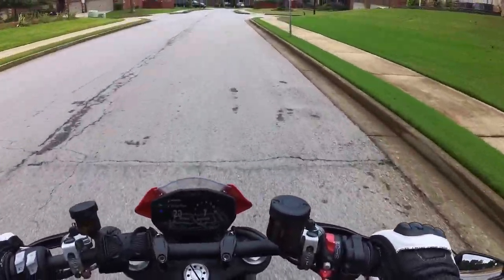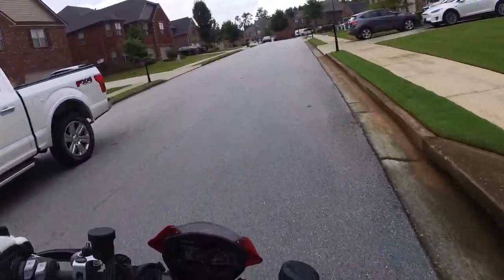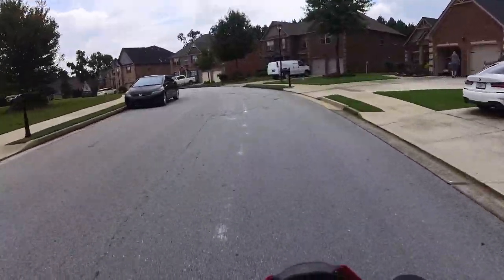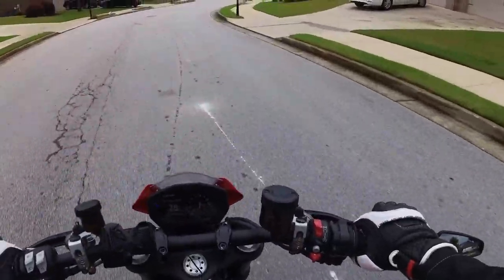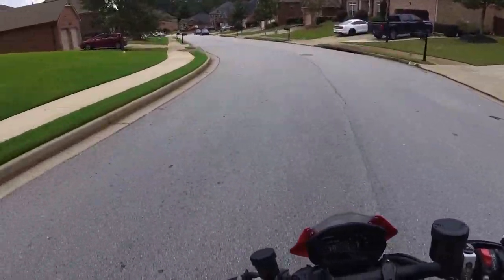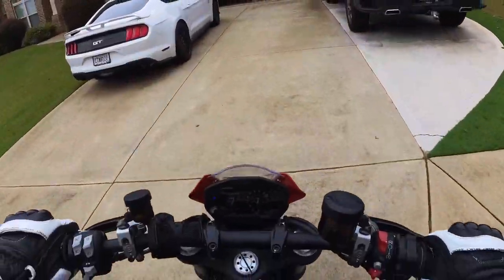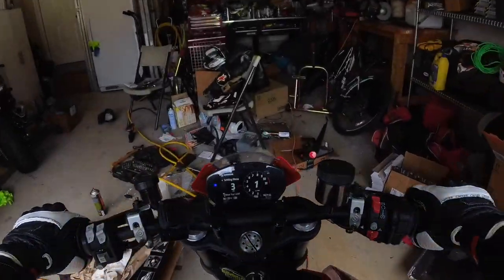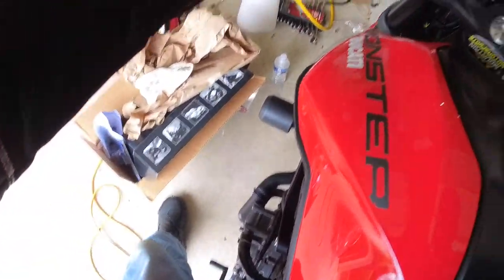Brembo, auto blip, TFT, LED lighting - all that stuff. That's my opinion. This bike is a hell of a thing - I didn't give it more than 30% throttle there, I just blipped it to 30% and the front just comes right up. This is a fantastic bike. Yeah, except there's something weird going on with the brakes - they're surgy, but they're not shuddering. It's definitely not a warped rotor. I'm going to have to put this up on a stand and clean those things with brake cleaner.